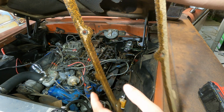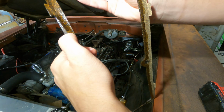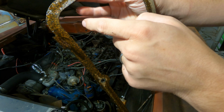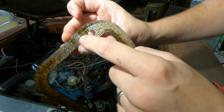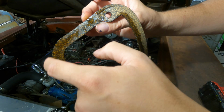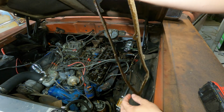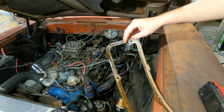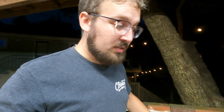But you can see the difference here is where this oil, there's a thin line of separation, then right there that separation disappears and it moves that way. So right there you can see the separation. Oh, now you can see right there a little bit of separation. You can tell where it's clamped down, wet on the inside, dry on the outside, but wet on the outside down here. That's the problem. And then it was probably just dripping down along and getting the rest of this bottom wet. So we're gonna go ahead and set that off on the side, get some brake clean, clean the valve cover up. We'll get some Permatex on the valve cover itself, you know, just goop it on there, it'll be fine. And then we'll see how it looks tomorrow.